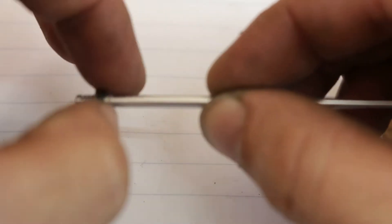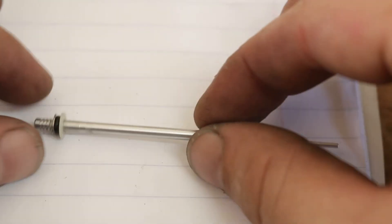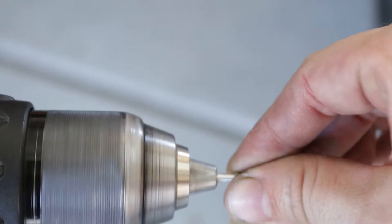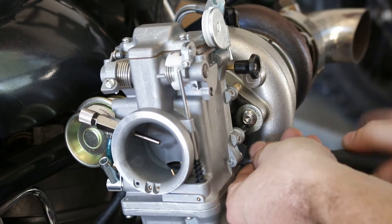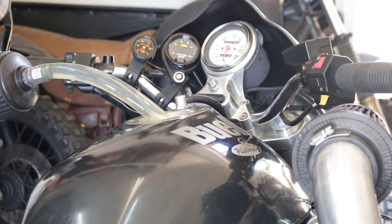The first way is to space the needle even higher up than the clip position allows by installing additional washers or O-rings under it. Spacing the needle higher up allows more fuel to pass by it, and the other way to richen the needle is to reduce the diameter, which I also did. To accomplish this, I chucked the needle into a drill and used some 120 grit sandpaper on the outside diameter. My recommendation is to start off with four 10-second passes at a low drill speed, applying moderate pressure. This should be sufficient to take off a thousandth or two thousandths of an inch at a time. After reinstalling the now thinner needle, I reinstalled the carb setup, poured gas in the tank, and took the bike out for its first ride.